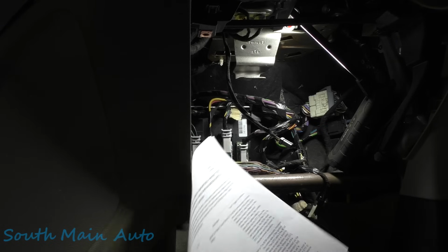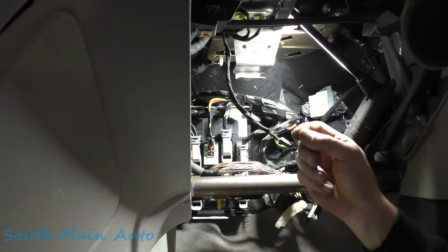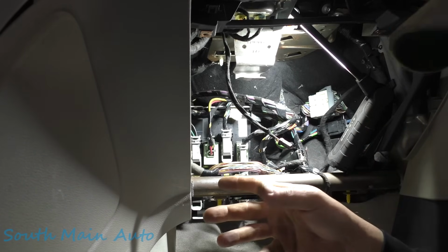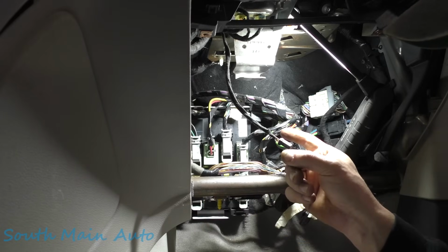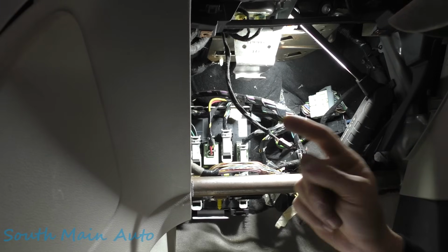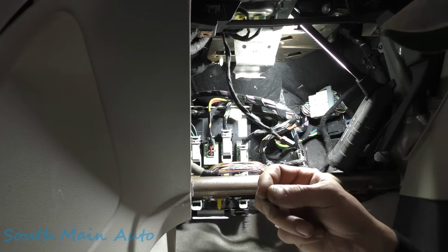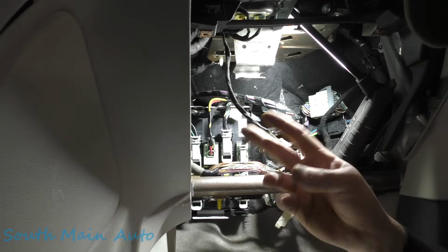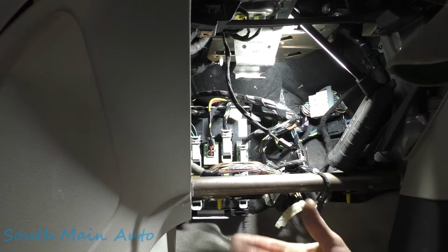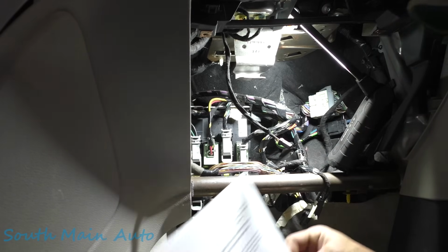System operates as normal. Well, we know one thing for a fact: it's the control side that's going to turn that relay on out there. We know that it is not shorted to ground. So it's either open circuited or a bad body control module. If it was shorted to ground, it would have turned on as soon as we stuck it in, because remember, we poked the control side with the test light and essentially turned it on using my claw hands. So that tells us it's not shorted to ground, so we're either looking at an open or possibly a bad BCM.